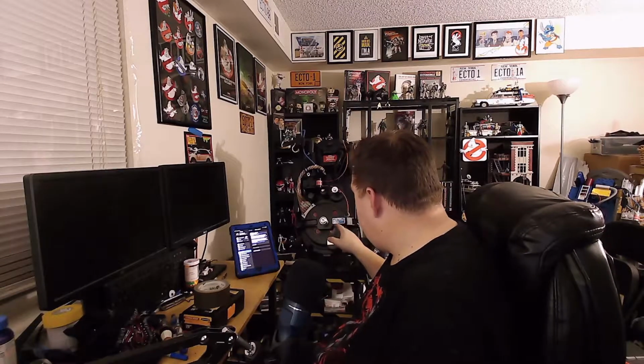I did an aluminum primer, the Rust-Oleum brand. I did silver also because I know over time, and already there's been a few scuffs and scratches revealing the aluminum underneath. So that's why I did that. I did a black and I also did a semi-gloss. And I did actually go over this with a light bed liner spray. I only had about half a can. Should have got more, but I didn't.